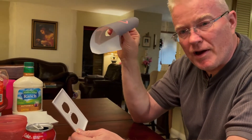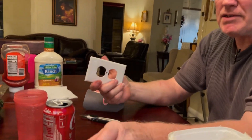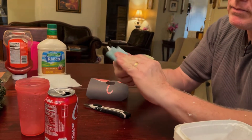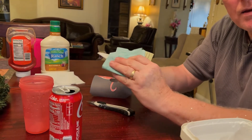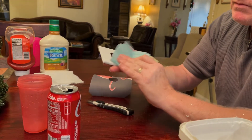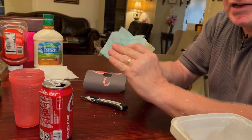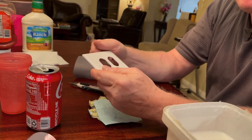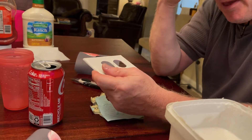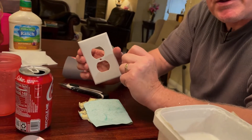After you find where the holes are and you've cut them out nicely, you take sandpaper and you make keys — K-E-Y — keys on the very slick, shiny surface, so that your glue or your paste can have something to grip onto.